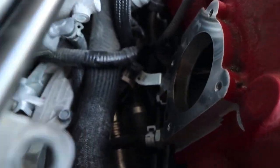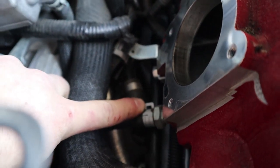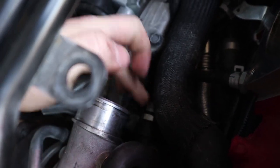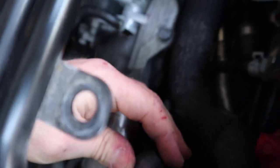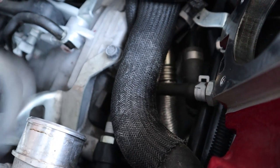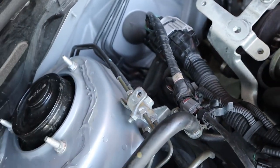So the throttle body is off. This is the hose we're interested in, so we're going to get a needle nose plier, remove that, and also remove the entire assembly — it's really difficult to see because of the bypass valve, but there's an entire assembly here that goes to the block and comes up here as well. We're going to take that entire assembly off, mess with it off the car, remove the PCV valve, install it in the AOS, then install some hoses and start running it.